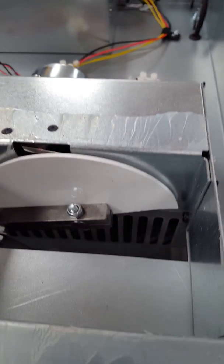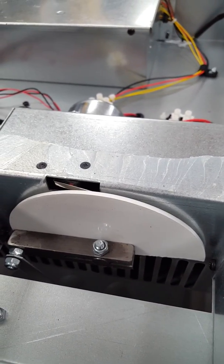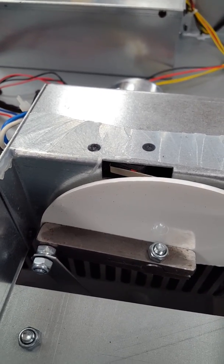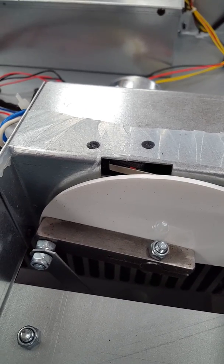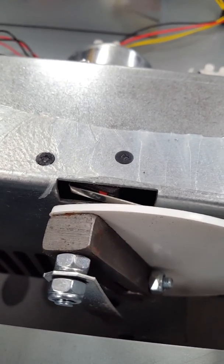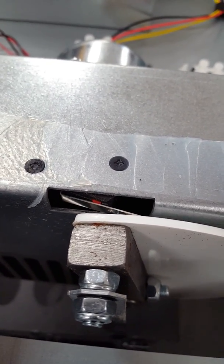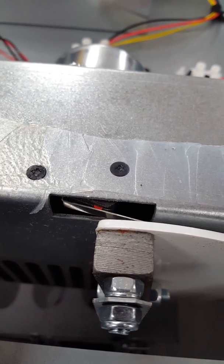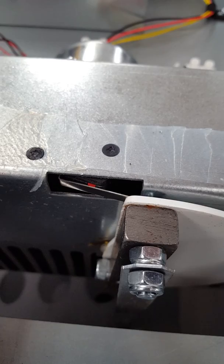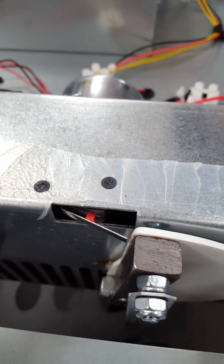Now I'd expect it to go round, and once the switch opens it will stop. That's what I would expect it to do. So that's going to carry on turning. You can see the cam is coming up. What should happen is the switch will flick open, turning the motor off. That's it — basically now the circuit is broken and the motor stops.